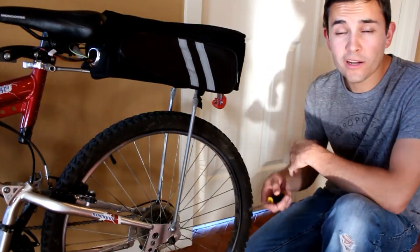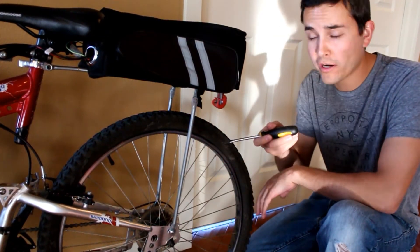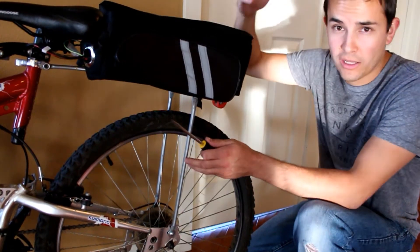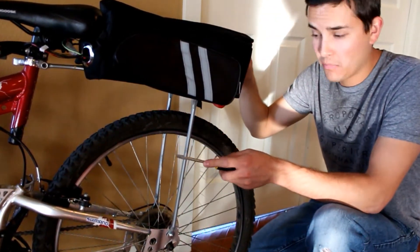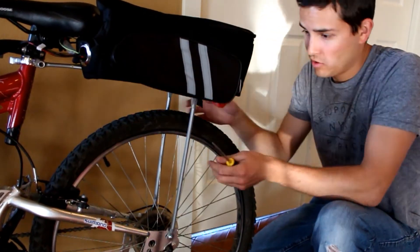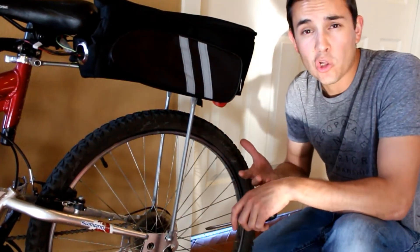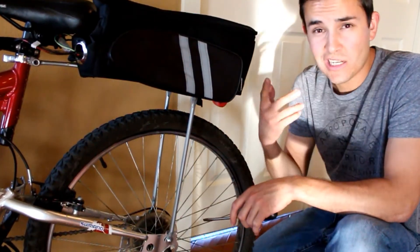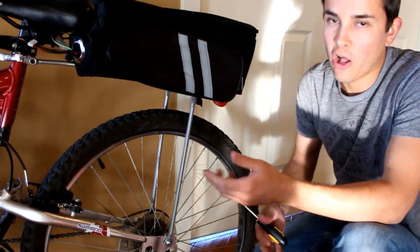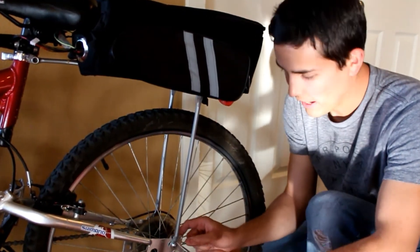Now I was working on a black bike, but I have the exact same bike in red and silver, and that's the one I'm working on right now. I'm installing the rear rack. The kit came with the rack and the bag — the bag Velcros to the rack with included Velcro straps. Head to your local hardware store and get two nuts and two bolts, which should cost about a dollar, and those go through to hold the rack on to the rear of the bike.